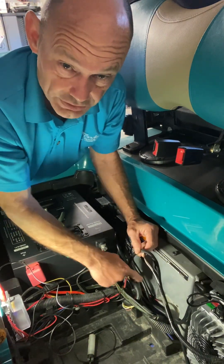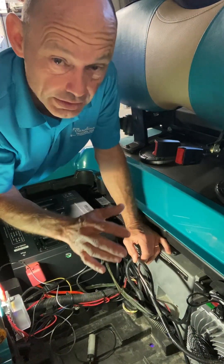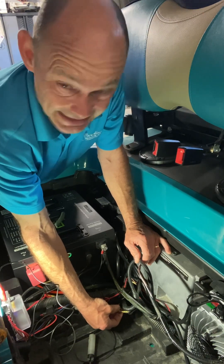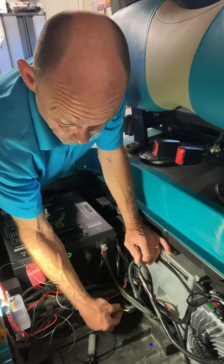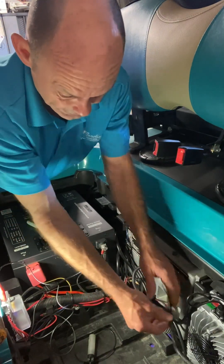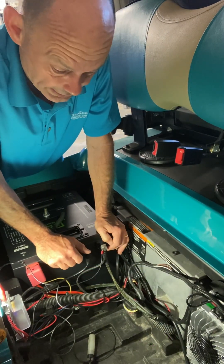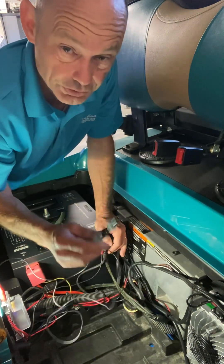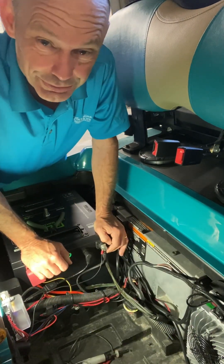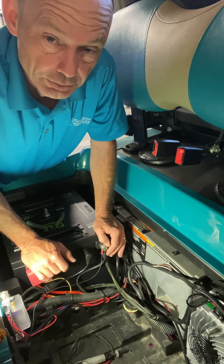My recommendation is to go before this split — it's only six inches away — and connect all your wires up there. Do your turn signals, do everything the directions told you, but use those four wires that are in that harness. Your ground left and right is the exact same ground; use those harnesses and make that connection right there. Once you're finished, zip tie everything back up like it was. This is super simple to figure out — very easy. Give me a call if you need help, I'm heading to the auction, but thanks man!